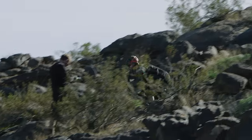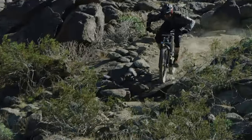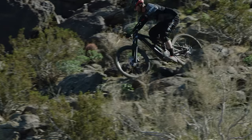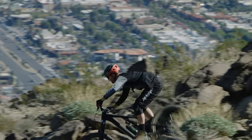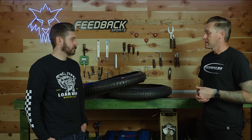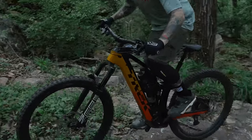The next is the casing it's built on. The rear tire is built on a super gravity casing—a little heavy for everyday trail use, not quite heavy enough for downhill use, but on an e-bike it's the perfect solution because of the added weight of the motor. You can be ultra aggressive, hitting rocks at higher speeds going uphill and downhill, so we use our super gravity casing. All of these are obviously set up tubeless, so you can still run lower pressures and have that power transfer from the motor as the tire works and conforms to rocks.